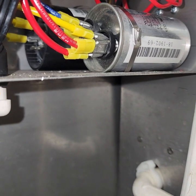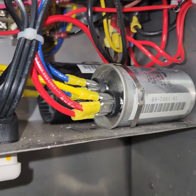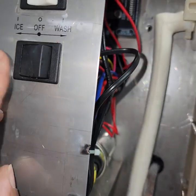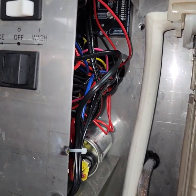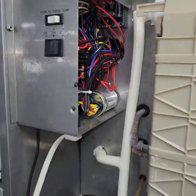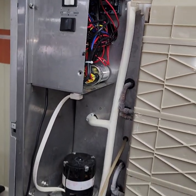When you get on this side of it into the electrical panel, you can see it's got three wires. One of your wires — the center wire goes to a ground, see a ground back there. And then the left side wire connects to the middle terminal on your ice/off/wash switch — that middle terminal there. There's three terminals across there, and that wire connects to the center terminal on top. And then this wire here goes over to the contactor, to the right hand side of the contactor, and it connects on the coil side of that contactor. There's two terminals there, and there was one red wire that was already connected. This was supposed to connect to that terminal right next to it, but it wasn't connected.